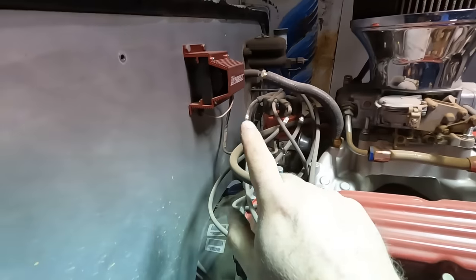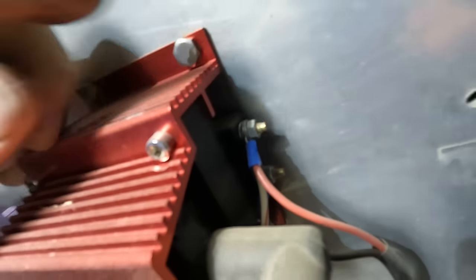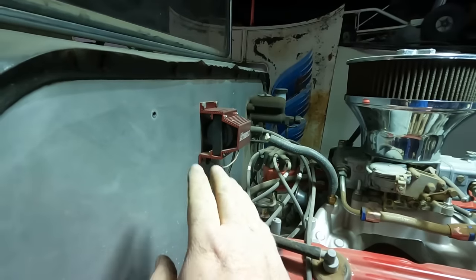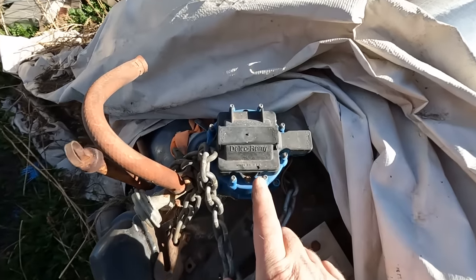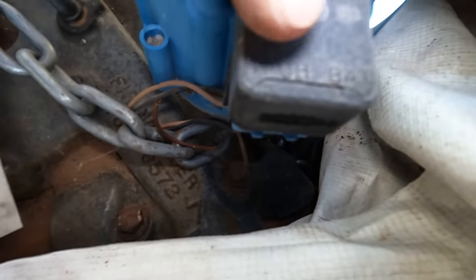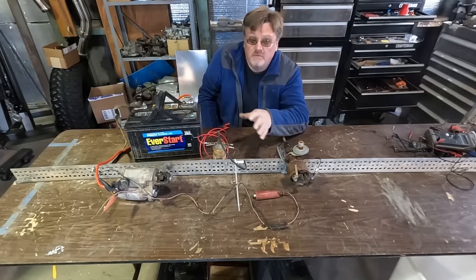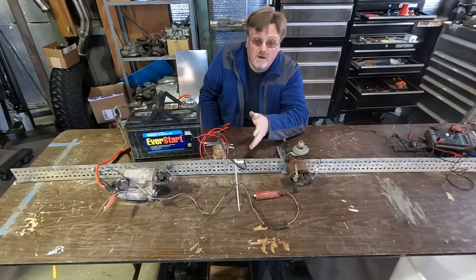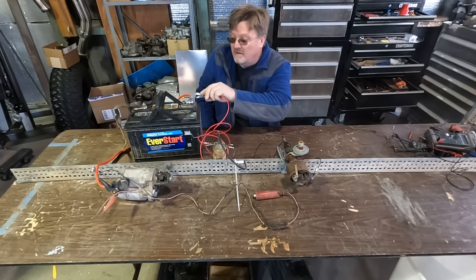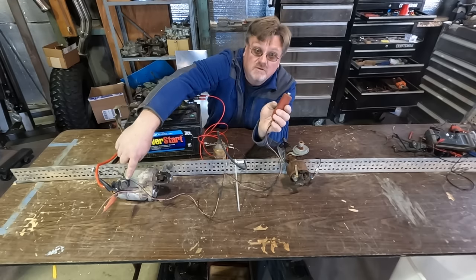On this engine it's running an aftermarket electronic ignition, which is easy too — you basically have a positive and negative on the coil, with a wire going to the distributor and a little control box. On GM engines, life is really easy: all you have to do is deal with two wires — one for ignition power and one for the tachometer signal if you feel like it. It really doesn't matter which standard ignition you have; basically you're going to have a power wire that powers it up. You can set up a system with your ignition on an alligator clip, or even get fancy and go with a starter button switch that connects those two terminals I hit the screwdriver on.